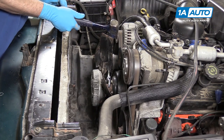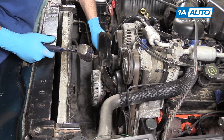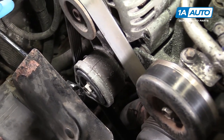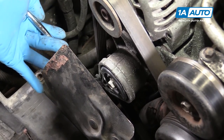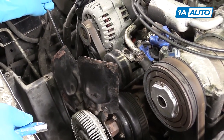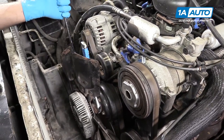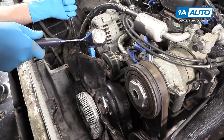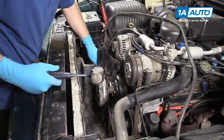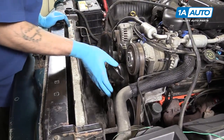We're going to place the wrench over the clutch fan nut and then strike it quickly with a hammer. Using the drive of a 3/8 ratchet — or you could also use a 3/8 breaker bar — go into the slot on the serpentine belt tensioner and rotate it as far clockwise as you can to put extra tension on the serpentine belt, then try hitting the wrench again, because this should keep the pulley from turning. Once it's loose, remove your ratchet and spin the clutch fan off.